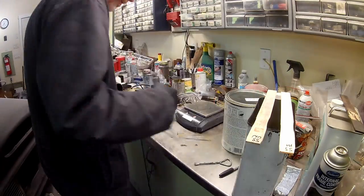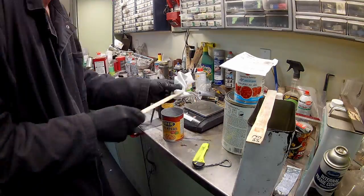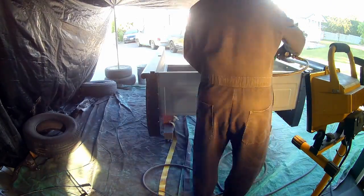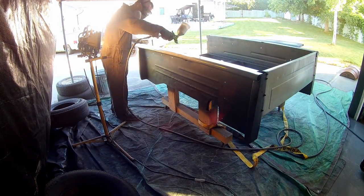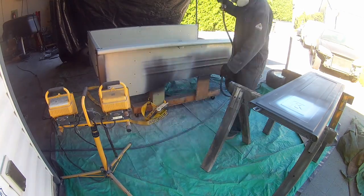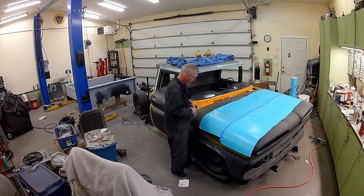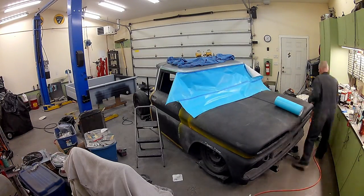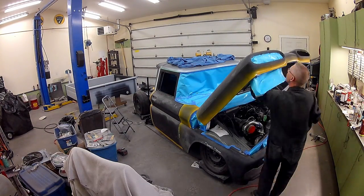This is my first time spraying slick sand. I like it, but I like it retroactively. At the time, this stuff sets up in the gun — it cures in the gun within 15 minutes at room temperature. And it's warmer than room temperature outside, and I was kind of learning — you really need to lay this thing down quick. This gun was a Princess Auto special, I think I paid 40 bucks, and it has a 2.3 millimeter tip. And you need to boogie. I think I even ended up taking out the filter inside the gun because it was plugging that thing up pretty quick.